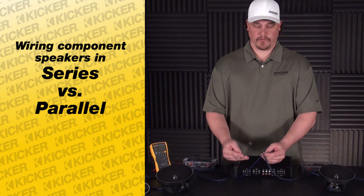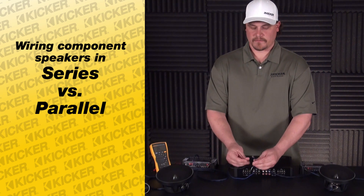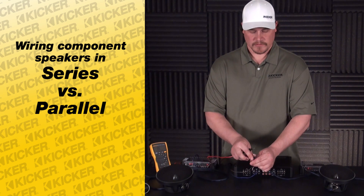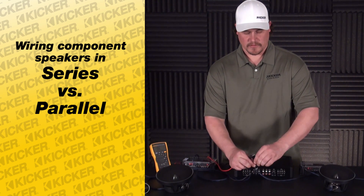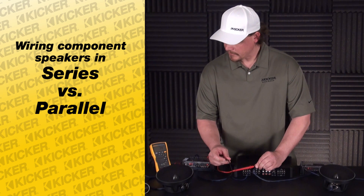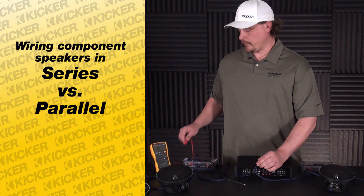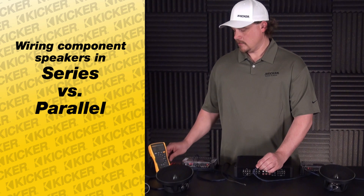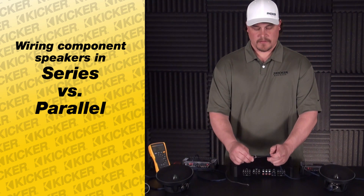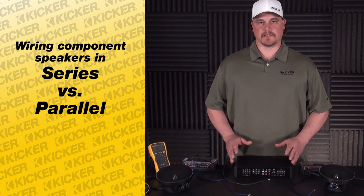If you take your multimeter, leaving it on the ohm setting, and test your speaker leads at the connections going into the amp, you'll see it meters out at about 7.4 to 7.5 ohms. Odds are your amplifier will work at this load, have a cleaner signal, the amp will run cooler, and you won't have any more issues of the amplifier wanting to shut down or run hot. Hope this helps out, thanks.